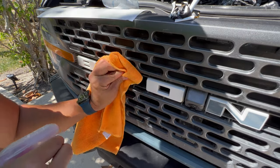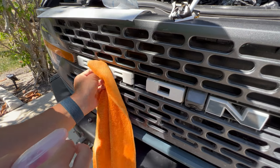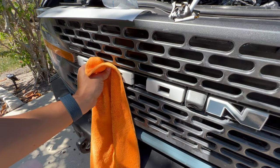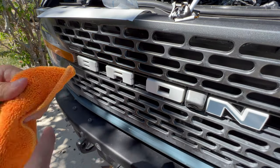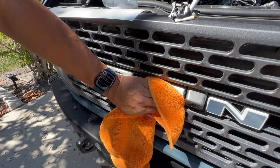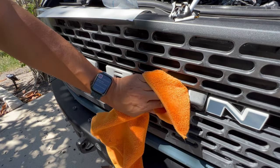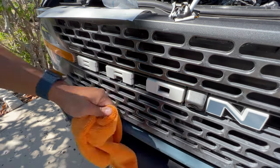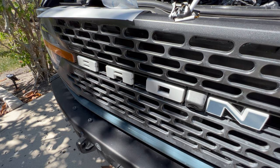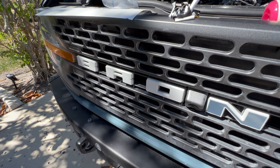It is 77 degrees right now. I like installing vinyl between 70 and 80 degrees. We are in the shade, which is great for when it's warm. If you do this in the sun, it will change the way the vinyl reacts to pressure — it can make it stretch a lot. We're just doing a nice little do-it-yourself overlay. A lot of the issues we get are with customers that do vinyl installs when it's really cold — you might want to apply a little heat, or just do this in the garage, or wait for a warmer day.